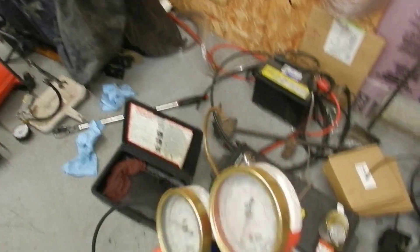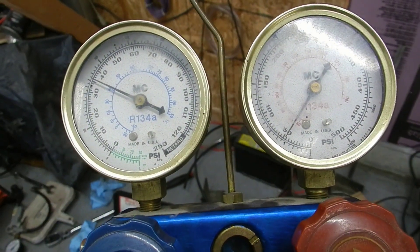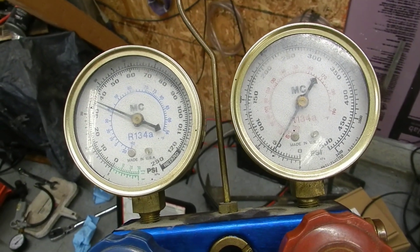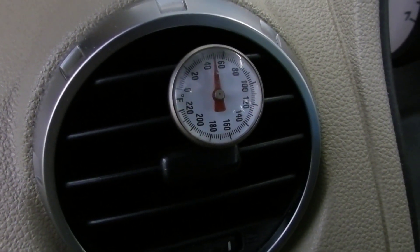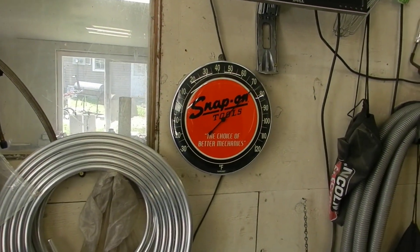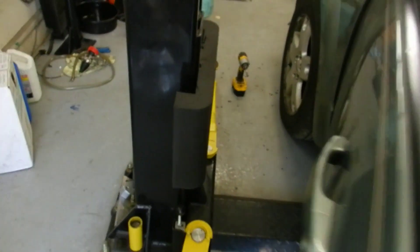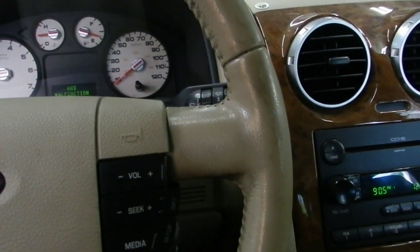Now that I actually have an AC machine that I can use, I will take these pressures and suck them out with the AC machine, putting them back in that reserve tank of mine. Not as good as I thought it would be, but it's definitely not too shabby. 50 degrees coming out of the vent — it feels really cool in this car, and it's a hot day today. That's the garage temp since I opened it — it's gone up a little bit. It was at 68. I'm going to go ahead and pull this car out. It is chilly in here — it is really chilly in here.